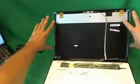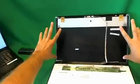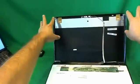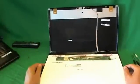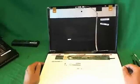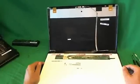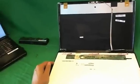Once you do get your screen in, connect the connector as I showed you, mount the screen on the metal mounting brackets, then tighten the screws at the bottom. Snap the screen bezel back on and put the two screws on top and two screws on the bottom and the screw covers, and you should be done — your computer will be as good as new. Once again, my name is Eugene Panrutkovic, I'm the laptop screen doc, and the name of the website is www.screensurgeons.com. Thank you very much and good luck.